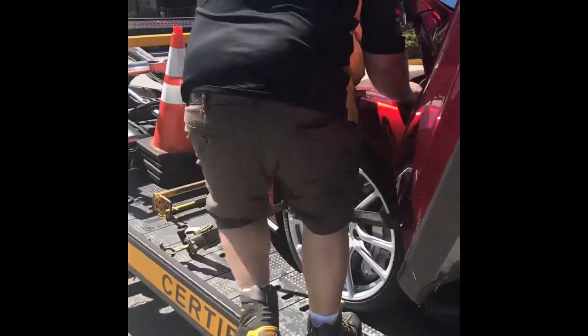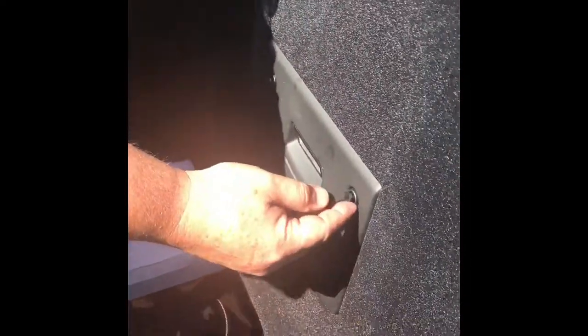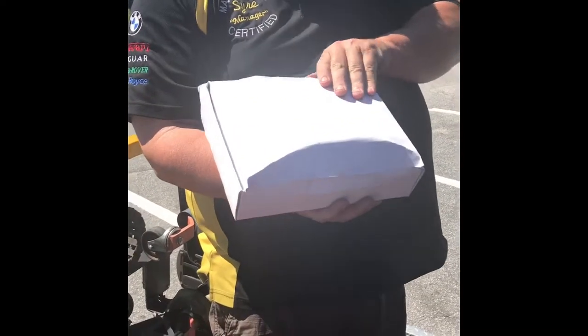With the hood compartment, you lift up the hood and right here is the battery compartment. You will take a screwdriver, gently take this out — this gives you access to the battery. This right here is an official McLaren battery charger, and this is what you're going to need to get this car going. The connections in there are small. You will need to put this car on this charger for a minimum of 8 hours; 12 to 24 hours is recommended. Now, because of the hydraulics on the brakes, without it running you cannot release this brake.